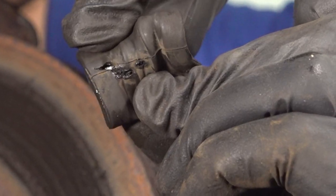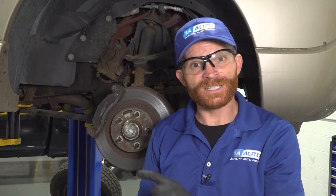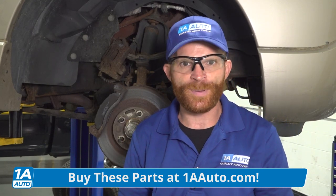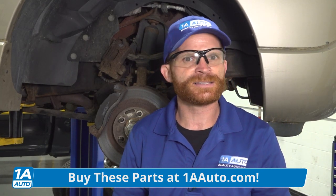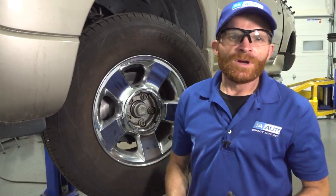If you see a tear in the boot, moisture can make its way in and you're going to have issues with the caliper slider — more likely causing braking issues and noises. This one does have a tear, and that's not good. Now, with everything said about what could cause a squealing or scraping noise from your brakes, does it make sense to only replace the pads but leave your existing rotors? It doesn't to me. You'll put brand new pads on, hear a noise, then find out you have to replace the rotors and pads again — it doesn't make sense and won't save you money in the long run.